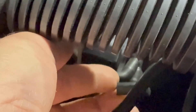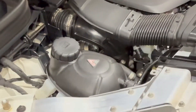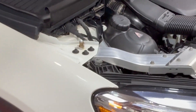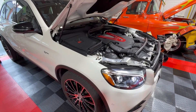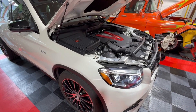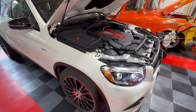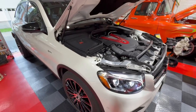I'm going to pull this hose off and squirt the CRC stuff into this hose right here. It's definitely drawing a vacuum here. To do this, the car needs to be at 2,000 RPMs according to the instructions — warm the engine up, bring it up to 2,000 RPMs, spray the CRC in short bursts so you don't stall the engine. Once it's empty, rev the engine up to 3,500 three times, then let the car sit for an hour.